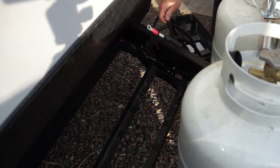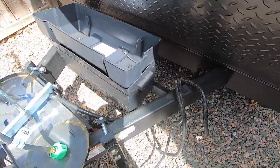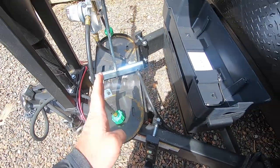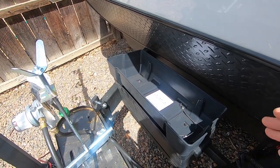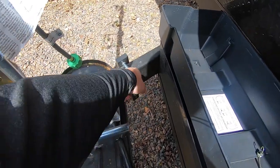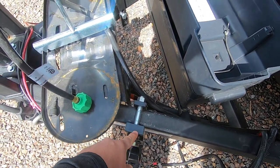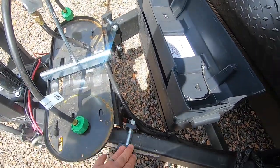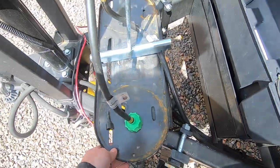It's been a couple of days and I ran into a comedy of errors. The propane tank mount was way too close to the new battery box — the lid hits it and you can't open it without tilting the whole box. The other issue was that the dealer-installed weight distribution hitch had a bracket that was further back and wouldn't allow the battery box to sit there. I was able to move that bracket forward and then move the propane tanks forward as well.